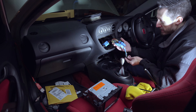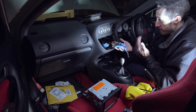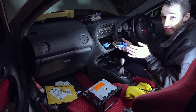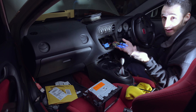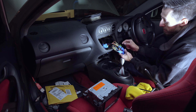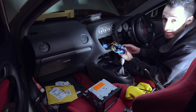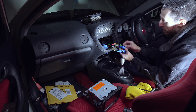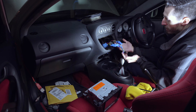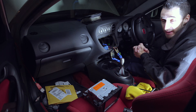So there you have it — a nice clean wire harness for the head unit, all tidied up. It does work; I tested it. The DVD now plays even with the emergency brake bypass. The bypass completely works, everything is good to go. If you guys are looking to buy one for yourself, I'll put the link down in the description below — they're very affordable, like $8. I connected the blue wire to the red accessory wire with a crimp, the green wire went to the green DVD input signal wire which goes to the e-brake, and I just crimped into the ground and tied it off. I've got the harness completely together and I'm going to go ahead and get the head unit installed, get the car fired up, and it's time to go for a drive.